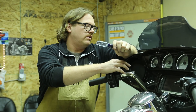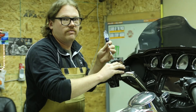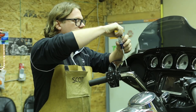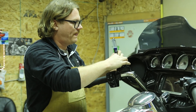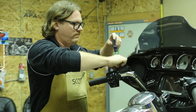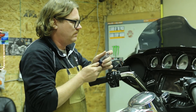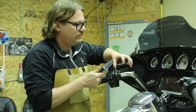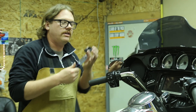I'm going to start with removing the clutch master cylinder cover so we can add fluid. There are just two Phillips head screws on here and we'll simply remove those. I already broke these loose but they're not very tight in general. When you take the cover off, just make sure you keep the seal in your hand and set that all aside.